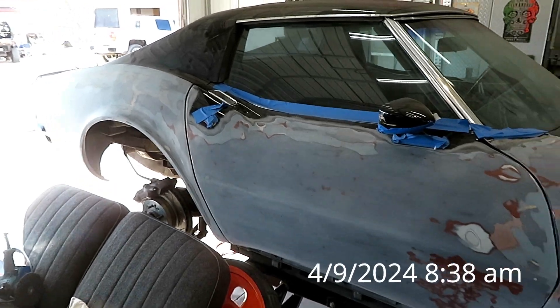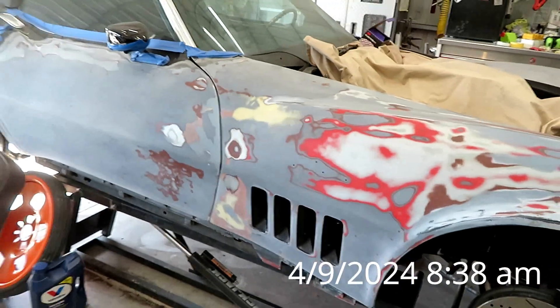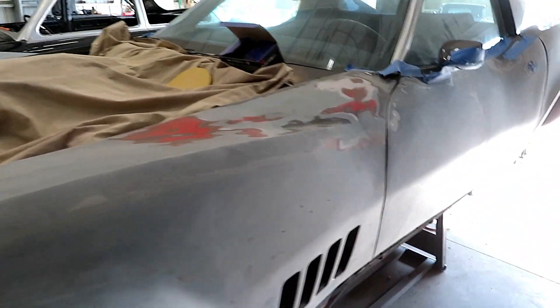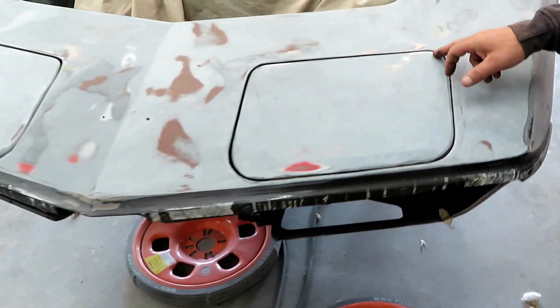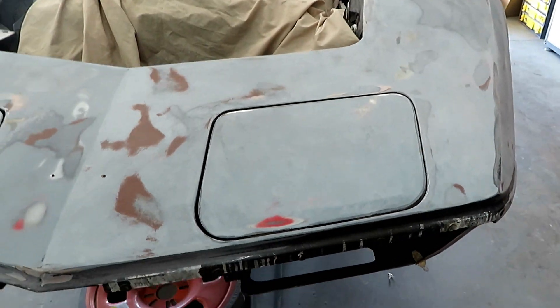On the Corvette, the '69 Vette - not a lot looks different, however Shannon has gotten it down through all the layers on the sides and gotten it where he wants it. The next thing to do will be to remove these tops, which are still painted, get down and do the upper part of the car, get all of that stripped. Then he said maybe later today he's going to pull these headlight buckets out - we're going to widen up the gaps, make them even all the way around. Same thing we'll do with the doors.